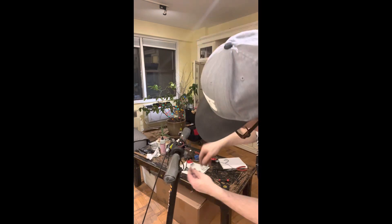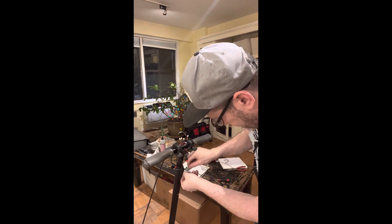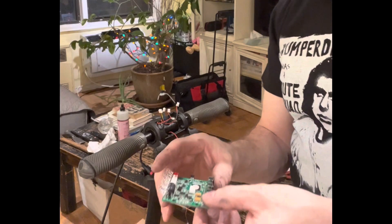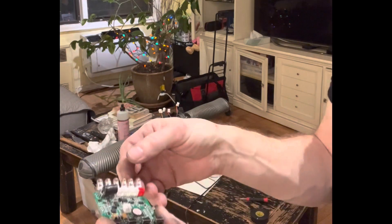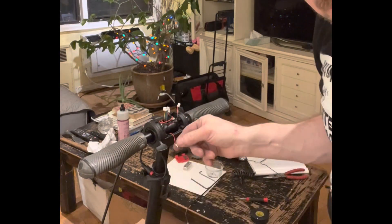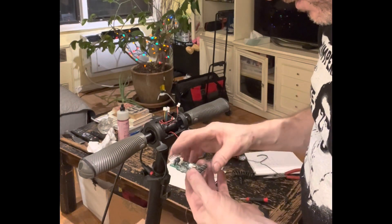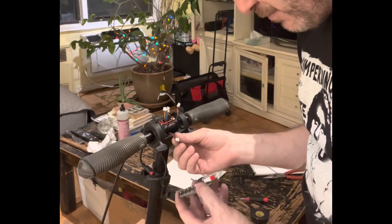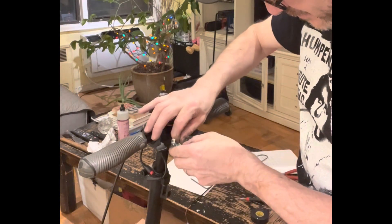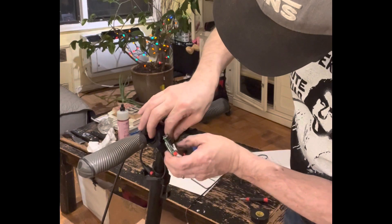The handlebar is now back in place. I'll tighten the one screw over here — this is the latch that holds the scooter when you fold it, the rear fender — tighten it up nicely. Now coming back to the LCD screen, you want to be really careful with this, it's kind of fragile. The one wire that comes from the bottom goes on — I recommend taking a couple pictures of how it goes when taking it apart. These connectors can only go in one way, just push them in.